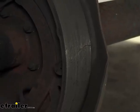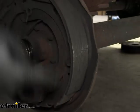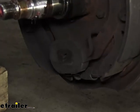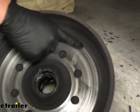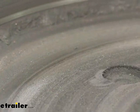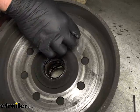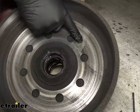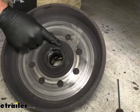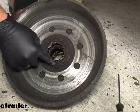So you can see here, before we take this old brake assembly off, we've actually got a little bit of a crack in our brake pad. But for us, that's not the biggest issue. Our biggest issue is that this magnet is no longer flat — there's a big groove in the bottom, and you can see what caused that is all of this uneven wear in this brake drum. This is actually a valley that it's formed and this is the highest point. So we're not going to be able to reuse these drums because this has to be very, very flat — almost perfect for that magnet to grab onto fully. That's why we were getting poor braking performance out of these brakes. In addition to that, you can see all this grease that has blown through this seal, and all that brake dust is sticking to it, which will also cause the brakes to malfunction.